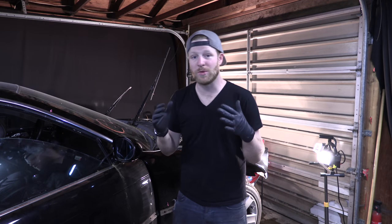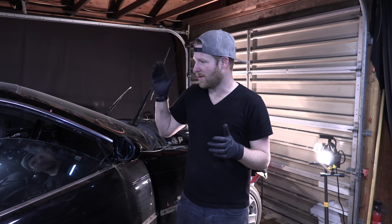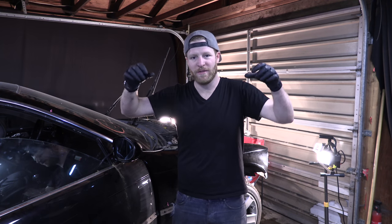All right, guys, well, it's been quite the whirlwind. This has been a really actually tough night for the radiator world. Our new radiator would not fit in between the two frame rails, and I didn't want to cut the frame rails to fit it in there. So I grabbed our BMW radiator and did some inspection to figure out what blew up on it when we lost all our fluid pressure. And it turned out that the drain plug blew off.